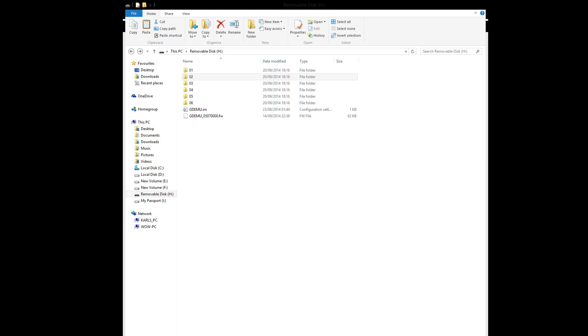This is the SD card that's going to go in the Dreamcast. When you download the GD menu program — I'll include a link in the description below for everything we talk about in this video — you'll get two files in the folder. One file will be the GDEMU.ini file, which we need to place in the root of the SD card. The other file is a README, which we don't need to place anywhere, just for general information. You'll also get a folder named 01.